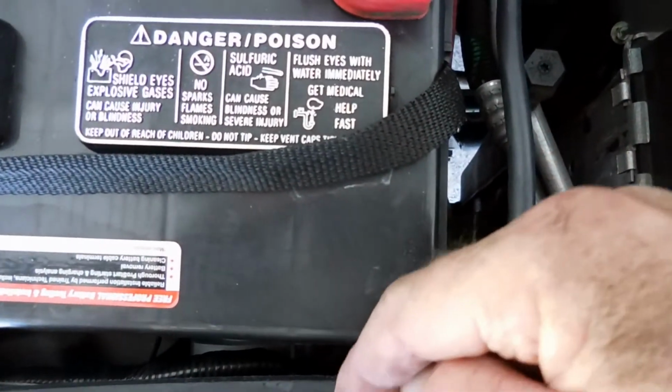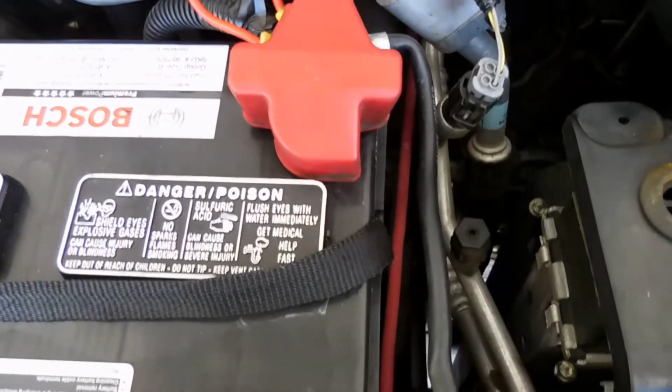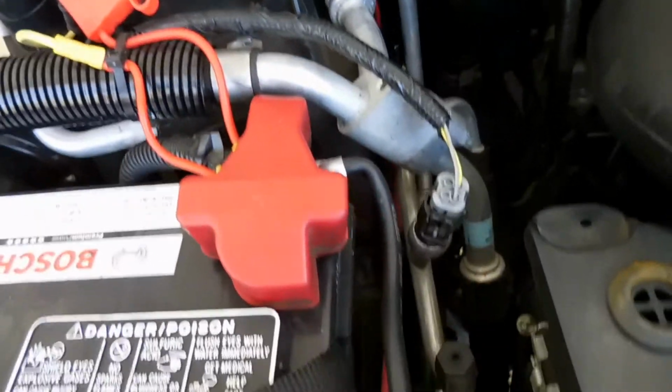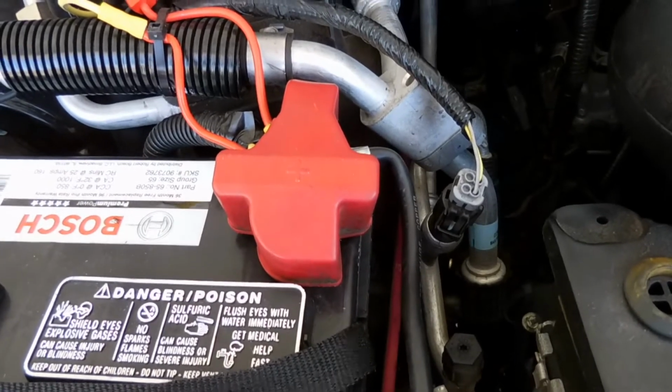I can't get a shot of it there, but you can see a glimpse of it there. Comes across the back and comes up and into that battery box that I fabricated. Okay, that isolation switch is down here, and again, this is that positive cable using, unfortunately, a black battery cable. And then down below there, I've got that positive lead going back to the auxiliary battery tied down in the path back to the rear of the van.